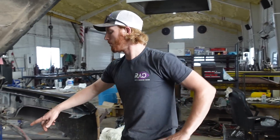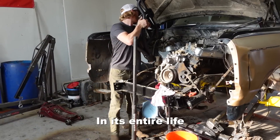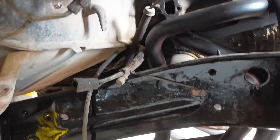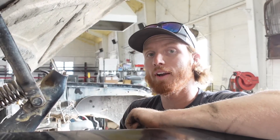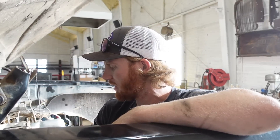To get these to go in, I think we're going to have to pull the motor mounts or just unbolt them so we can lift this thing straight up. These are the second pair I've ordered — the first ones I ordered said they were for this motor but they were actually for a small block Chevy. This is a small block Mopar. I read a lot of reviews that said it worked on Ram Chargers and D150s, but it's definitely not fitting.